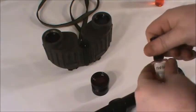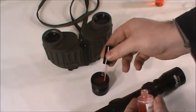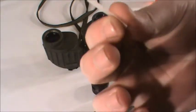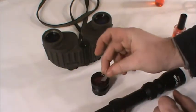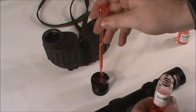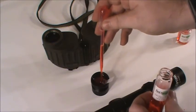Using the 15ml vial and brush, we want to re-wet the surface of the polymer near the O-ring. Take the mesh strip and bend it into roughly a 90 degree angle. Then place it on top of the spot you just re-wet and apply more polymer over the top of the strip. This will embed the mesh strip into the polymer without it touching the lens.